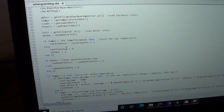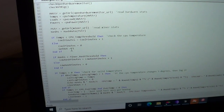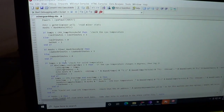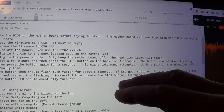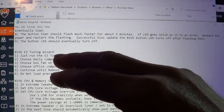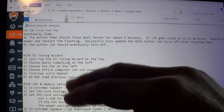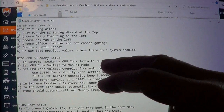There's some minor logic on what to do with the CPU temperature. The watchdog won't reboot every minute if the miner never got working — if the miner is totally down, it'll actually wait an hour before trying again. For the BIOS instructions: the first steps are just to get your board updated. If you just bought the board, it might not have the latest BIOS compatible with the processor — the board can actually update without using the processor at all. Then run the Easy Tuning Wizard, set those parameters, and if your system is unstable you can raise your voltage a little, but keeping 1.1V makes the system extremely efficient.